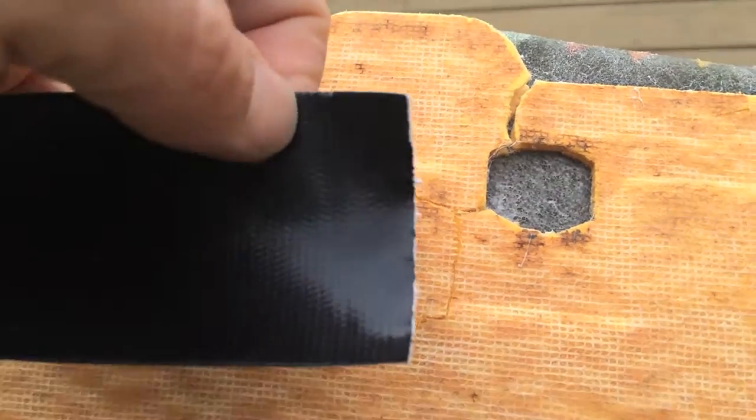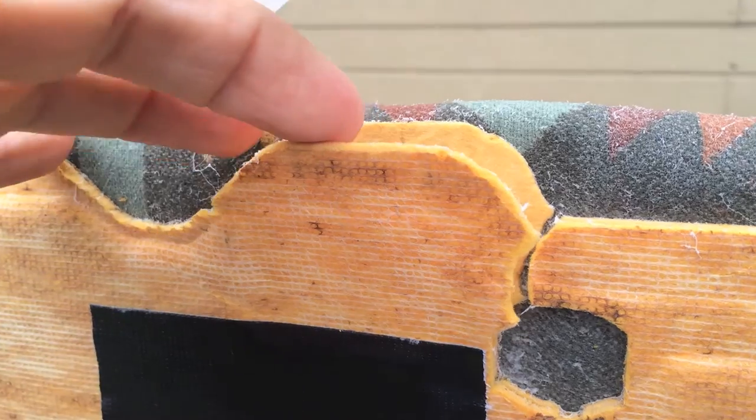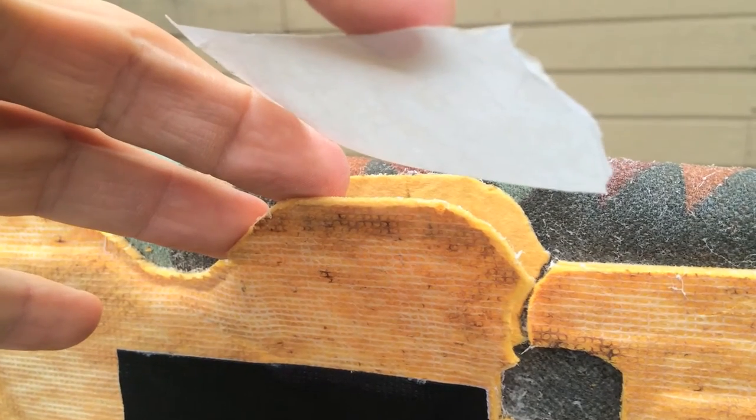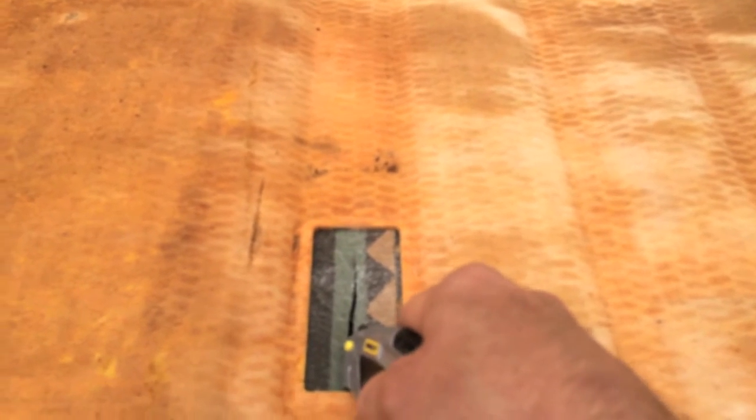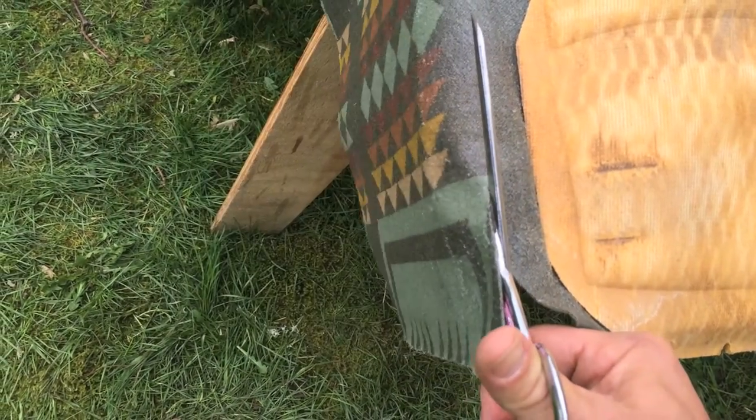There are a couple of little rips, and I'm fixing those with gaffer tape. I'm also putting double-sided carpet tape in between the separated areas. The pieces that came up from the seat belts didn't want to come out because the knob had some sort of proprietary head underneath that I could not get loose, and they were tripping me up. So I just tied them together, and now they're helping to support the headliner as it goes back in.